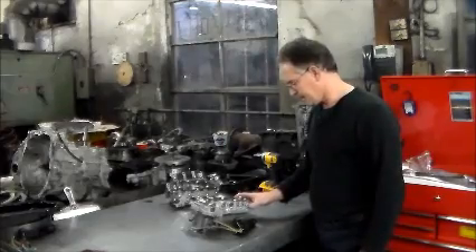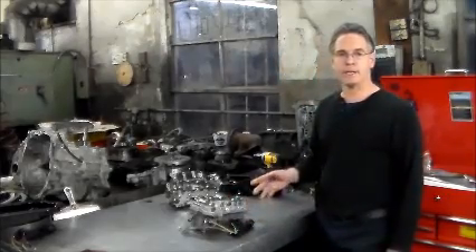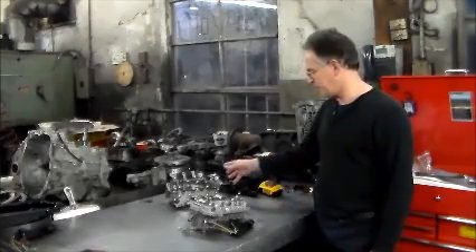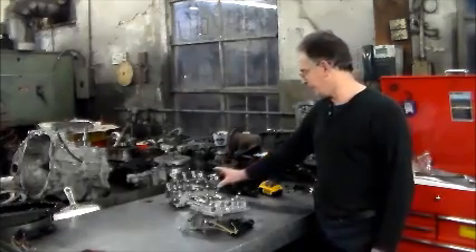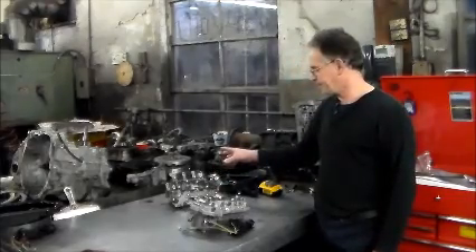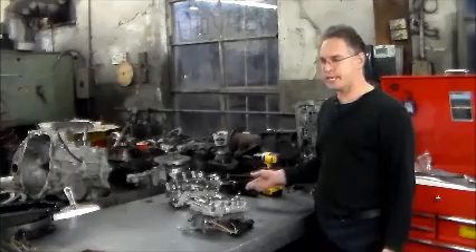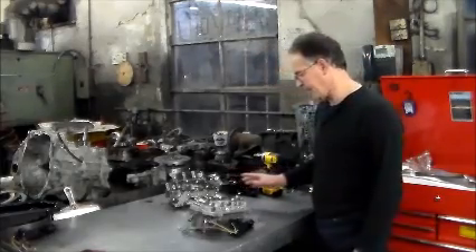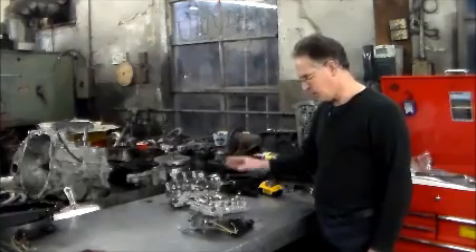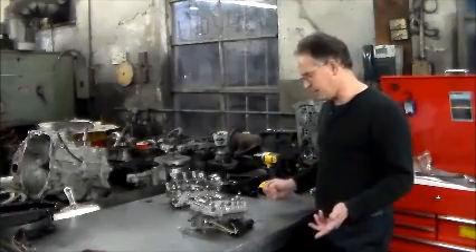What I'm actually doing is switching out the SLT solenoid and the internal harness. We're going to put it back together, drive it, and see if that fixes it — because I have the solenoids out of a good valve body. This is out of a 2012 Camry with a 2.5. What happened with this car is the people elected to send a used transmission down; they didn't want to go for the overhaul. They said we could have the core. I know the SLT solenoid is good and the harness is good and everything is the same, so we're going to do a quick swap, put it back together, drive this thing, and hope it's going to fix it.